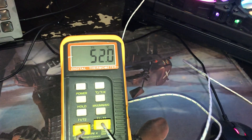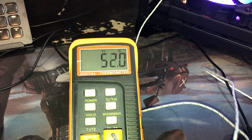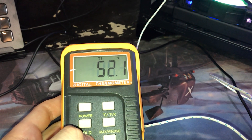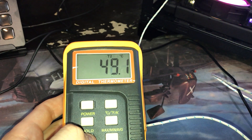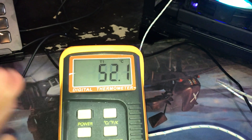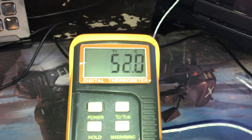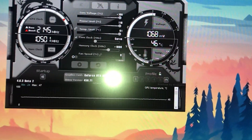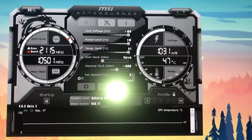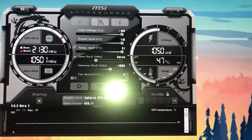Let's do some benchmarks and give it a shot. Would you look at that? We actually lost four degrees on temperature one and five, six degrees on temperature two. So it does work better with a solid backplate — it actually does. We also lost two to three degrees on the core, which is impressive. It actually made a difference on the core this time.